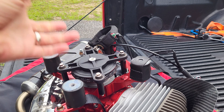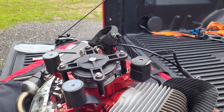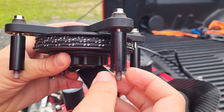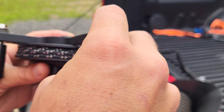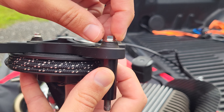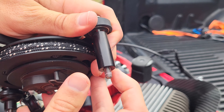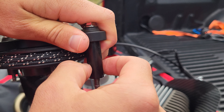The first process is taking off the pull start — it's going to take an eight millimeter. Shout out to Sky Sports USA for hooking me up with all the parts needed to do this job. On the Factory R, this is a smooth spacer here, so you can actually just use your fingers to hold it, or you can put a rag around it and use a crescent wrench. On most 185 engines I've seen, you can put a 13 millimeter wrench around here — it's got notches for a 13 millimeter.